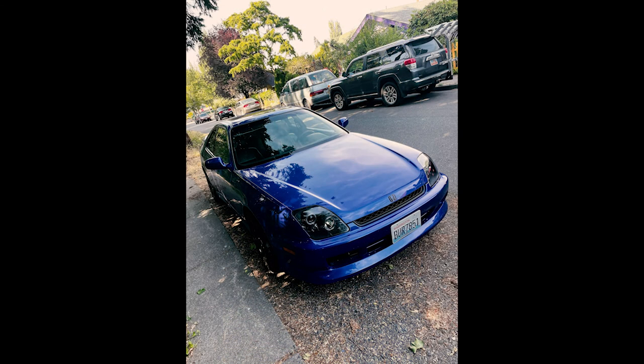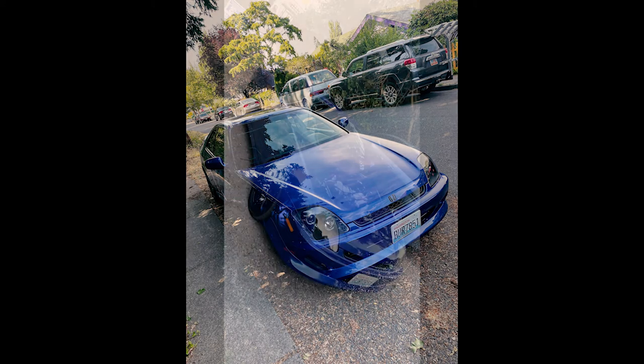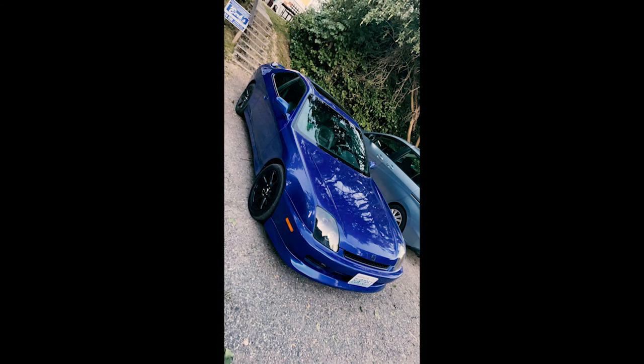Making this video definitely has me a little bit nostalgic and bummed out that I sold the car, but we move forward. So yeah, basically you're gonna put those 6x9 speakers, it's just four bolts per speaker, wire them in, and then put the covers back on the doors, put all the interior back in, and then you're ready to rock and roll. You're ready to listen to some EDM, listen to some rap music.